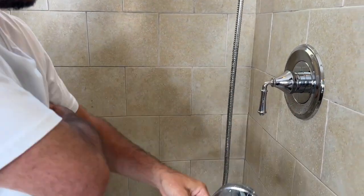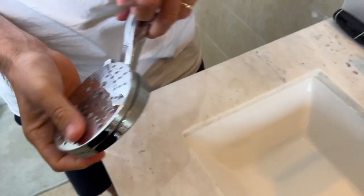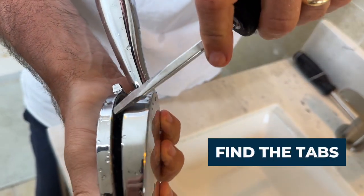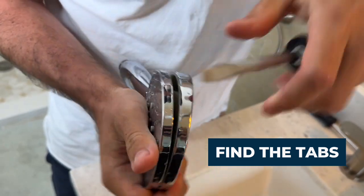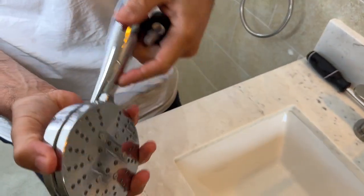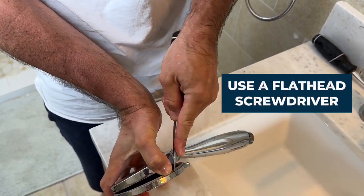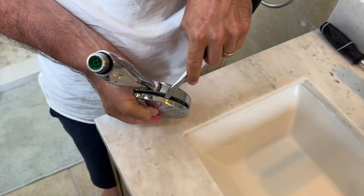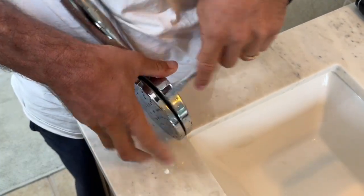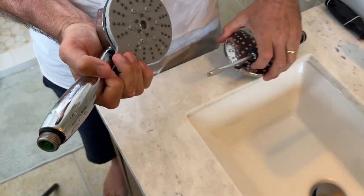So I'll shut that off and disconnect. There's a tab in here, a tab up here, and then tabs over on the same side — four tabs in total notches. All you need to do is just get a flathead screwdriver into those tabs, just don't poke yourself, and work the screwdriver in there. Now the plate is off.